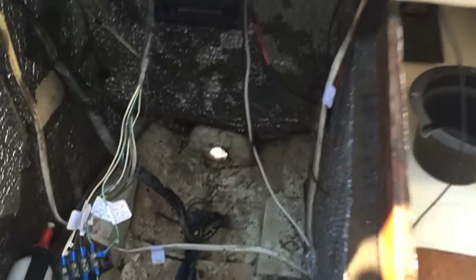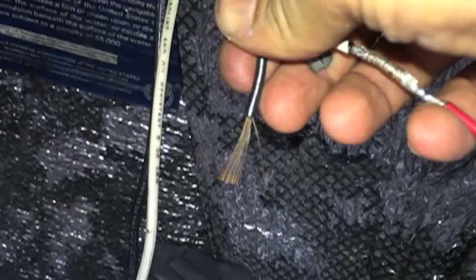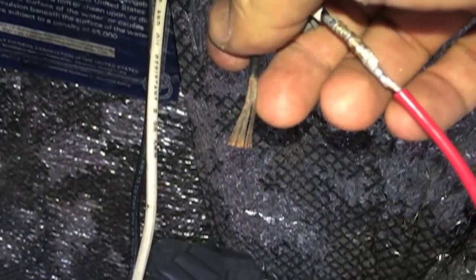I'm wiring up my GPS right now. I cut back a couple inches to splice. Corrosion — that was just a ridiculous pigtail. When I pigtailed it and wrapped it with electrical tape, this corrosion moved up about two inches up the sheathing. It's brittle and corroded. At any given point with enough corrosion, I could have just lost my GPS out there, and that would have been pretty lousy.